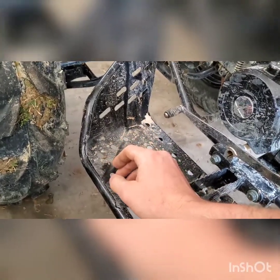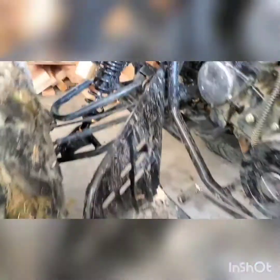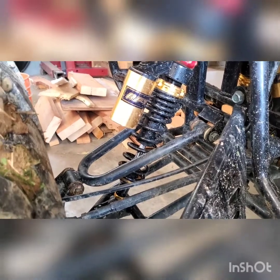That cut should give me more than enough clearance for full turnability. I did do the shock upgrade in the front because the factory shocks are absolute crap — no give whatsoever, rode terribly, and combined with the very limited padding on the seat it would hurt you after about an hour.